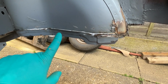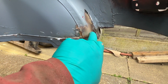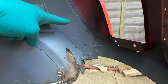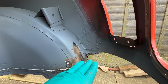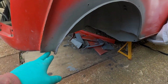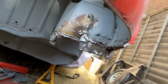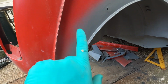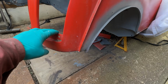I know you could use a grinding wheel. I find a flap wheel a bit more effective in this, or I've got a rubbish grinding wheel, but I can grind all these bits back to the underneath panel, and then I can look at what I'm going to do here, because I have got this whole panel section, this bottom corner from about there downwards to the flange. I don't know whether I'm going to run it or not. I'm a bit 50-50. There's no actual lip on here, but it wouldn't be the end of the world to put a lip on here, but there's just kind of like an ugly bit up on that edge where the original corner panel went. So yeah, I'll have a little stare, have a little think. I might end up running the line here, then I can put that corner piece in. We'll see how I feel and how it looks.